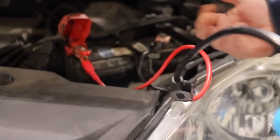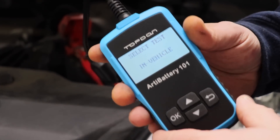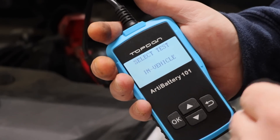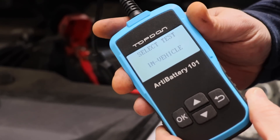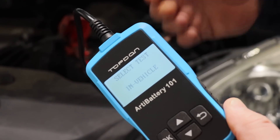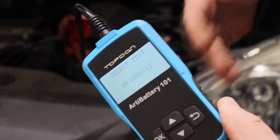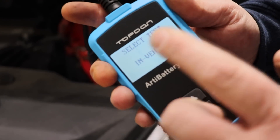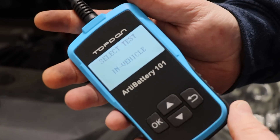Maybe the charging cable wouldn't be long enough at three feet so you cannot view the screen in the car, but you don't really need to. You can do most of the functions outside of the car aside from the cold cranking test — for that you can just lay it on its side, go start it, and it'll tell you what the reading is. Obviously I'm really pleased with it. I was wondering about this battery since it is four years old and it does have a 100-month warranty, but I checked it with the multimeter and it was fine. I'll have a link in the description of me checking a battery with the multimeter to give you an idea, but it's not true cold cranking amps — it just shows you voltage. Be sure to check out the links in the description below. Feel free to post any questions or comments — thank you guys, and as always, thanks for watching.